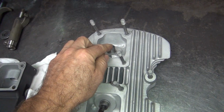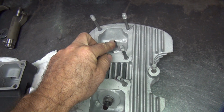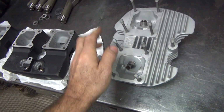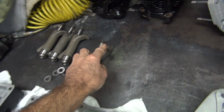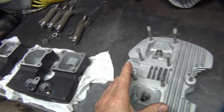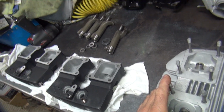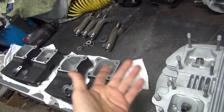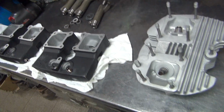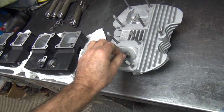And you put the felt tip up on here or some kind of marking pin, and run it through, and it'll leave a mark on the valve, and leave a mark on the rocker arm. I'm more concerned about the rocker arm than the valve. And you'll see the contact patch. Then you take it back apart, and you'll see all the marks, make a change if needed, and then you put it back together again and check it again. So there's two different ways of doing things.